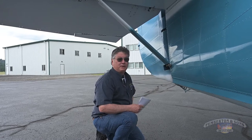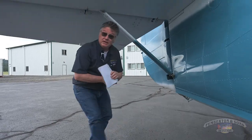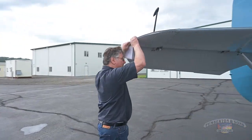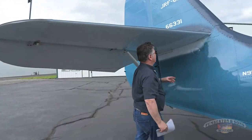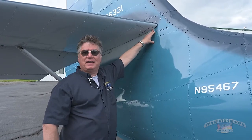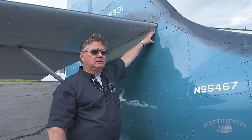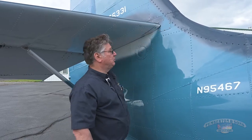This is a very high-stressed part that I always inspect carefully — I bang the strut to make sure things are secure. I also go to the horizontal stabilizer and bounce it to confirm things are solid. There's also an AD every 50 hours where we check the front horizontal attach fitting for cracks — that's a visual inspection or dye penetrant, done at virtually every 50 flight hours.